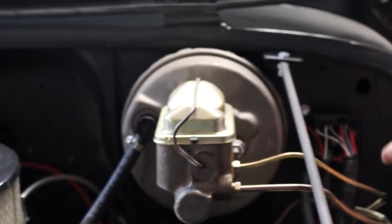Well, we measured where to mount our clutch master cylinder. Originally, they go all the way up here, but our power booster gets in the way, and this whole area is really busy. So right here is kind of the only place we can get it. That's going to take away from our clutch travel a little bit, but it'll be all right. I hate using hole saws, but...